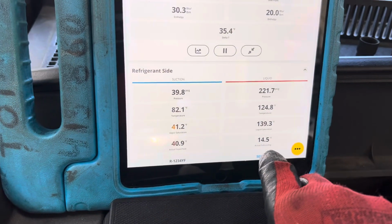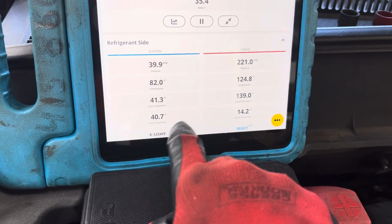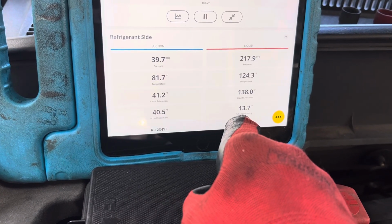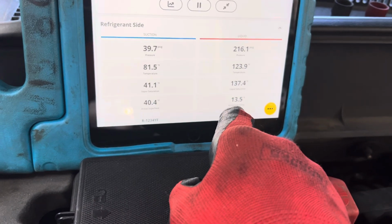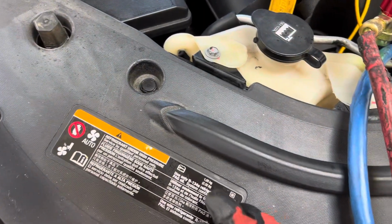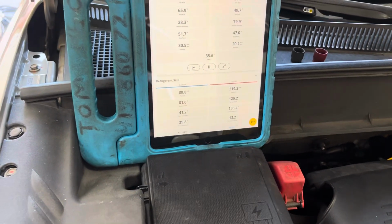So let's come over here. Where are we at? Our superheat actually came down. Look at our subcooling. We are no longer at 0.5 or 1.5. Our subcooling actually moved. It took that much to actually do something. We had to get right close to the 1,050 grams before the subcooling actually moved.